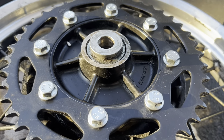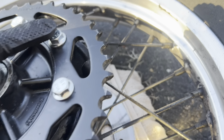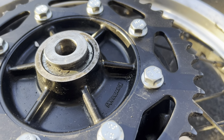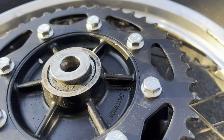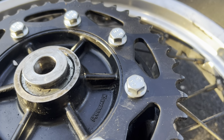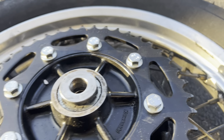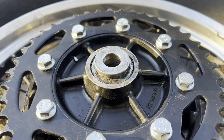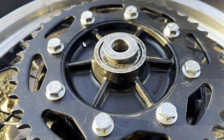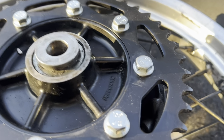And there we go. They're all torqued down, all except this one, which I believe is starting to strip the threads underneath inside the hub. So I don't know how much we actually just did with this entire job, because now one of the 8 hub bolts is loose, but it's in there. It's probably somewhat tight, you know, can't loosen it with my fingers. So whatever. I will put a link for these bolts in the description. You may want to consider getting slightly softer ones, because as I said, that one is stripping.